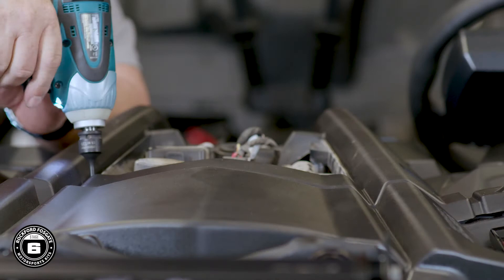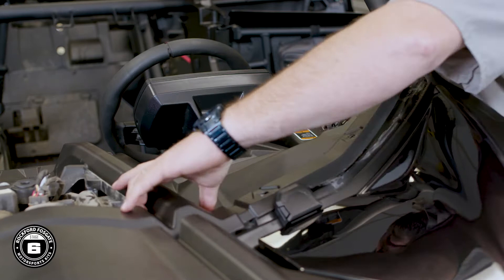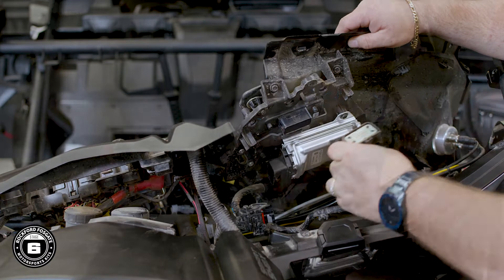Then remove the passenger side panel. To remove your driver's side panel, lift up and disconnect the headlight switch along with any other accessories and detach the cable sticks. You'll disconnect the harness to the smart lock module by pulling the red pin out and pressing the black catch. This can be very tight, so listen for a click. Then carefully remove the plug along with the two additional Christmas tree stays. Use a plastic pry tool to pop out the panels on both sides of the center console.